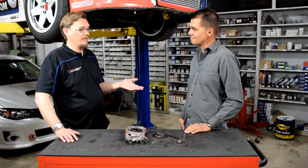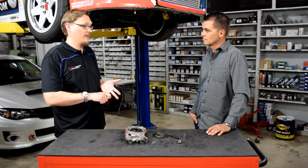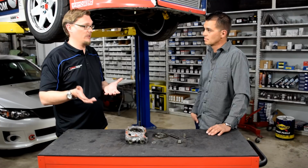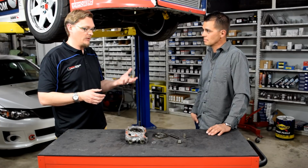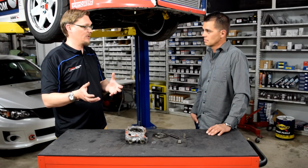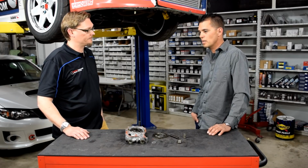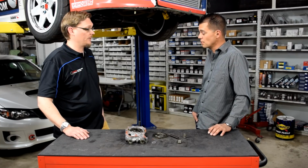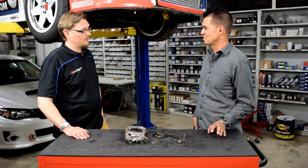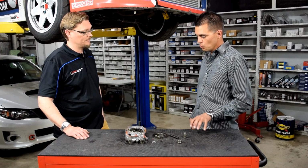Sure. Because in the case of an engine builder, usually they will have a spec as far as bearing clearances, and they should have some idea of what volume flow pump the engine is designed for. So that's definitely something well worth reaching out to. Yep. But in your case, making a motorsports engine that you made a slight change to, it was a pretty dramatic change that you had to make to get it back to normal, even with that looser tolerance. And it's hard to say too. Assuming I didn't have any of the gauges and just left it alone, it probably would have been okay for a while. Again, we're throwing details out the window assuming that, but trying to take some time and at least get some information about what the situation was.